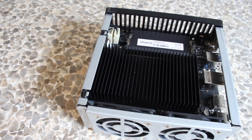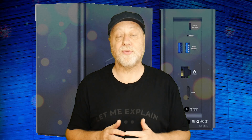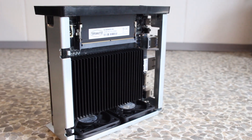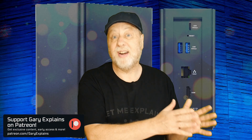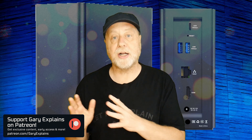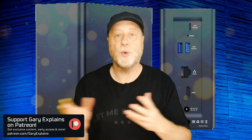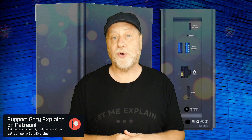At the heart of the F4 SSD is an Intel N95 quad-core 64-bit CPU that clock boosts up to 3.4 gigahertz — a 15 watt processor. It also has 8 gigabytes of RAM, upgradable to 32 gigabytes. The reason you want such a powerful processor and large memory is that modern NAS devices can do so much more than just serve files as a Windows shared drive — we'll get to that when we talk about the software.